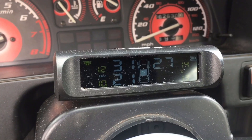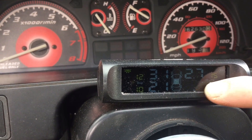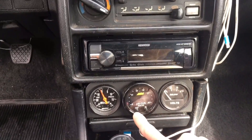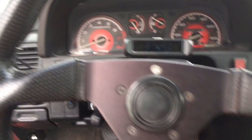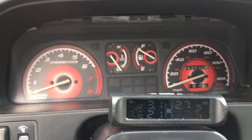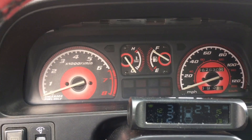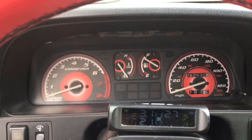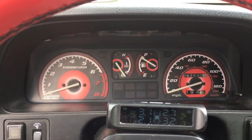What you hear beeping right now is my tire pressure monitor system — looks like two of my tires are a little over pressure, so I'll have to fix that. I've got a Kenwood radio, an AutoMeter boost gauge, an AEM air-fuel gauge, and an AutoGauge for voltage. I also have an install video on how to do the Type R cluster overlay — check that out. The cluster itself was given to me by a guy at work, has 62,000 miles on it, and I had to de-pin and re-pin it to make it work since it was from a different year model.